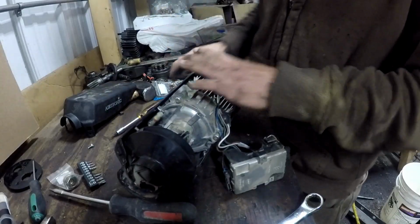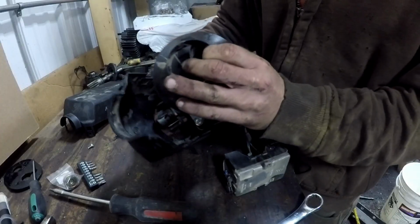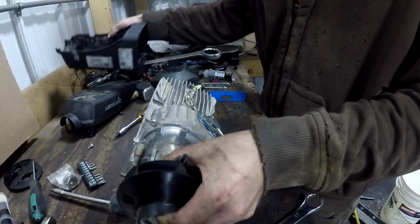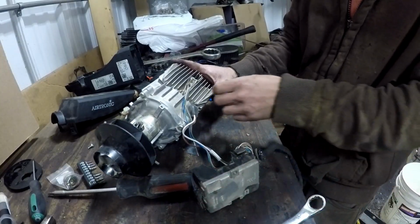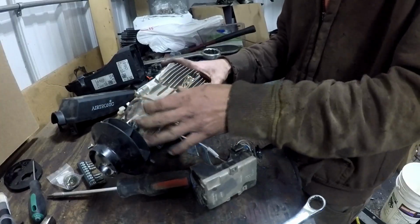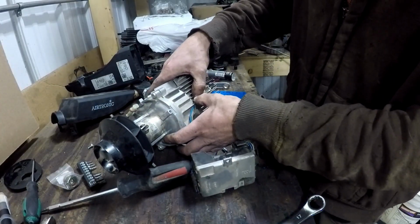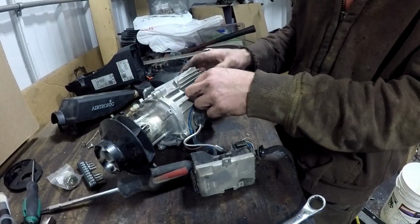You then need to remove the plastic cover on the outlet side of the heater in order to finish removing the heater out of its case. I then removed the flame detect sensor, although in hindsight it probably would have been easier just to unplug it and leave it in place. It does not need to come off.